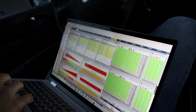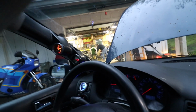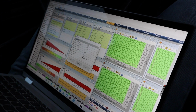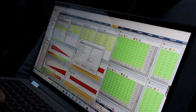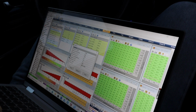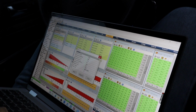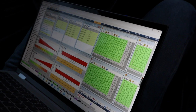I think it shows it. What's the max you've seen? Well, you got a couple gauges up here, it's right here, logbook. Highest RPM I've gotten, 72, 69, I don't know. It's set at 7,000, but maximum coolant temperature, intake temperature, time on full throttle, 266 kilopascal, whatever that is. I think that's the max boost it's ever read. That might not be right, though. Shouldn't that be 2.6 bar? That's a lot. Because 100 kilopascals, unless it's a different reading as far as boost pressure or something. Because I'm pretty sure 100 kilopascals is one bar.